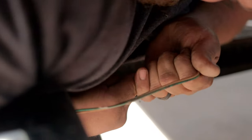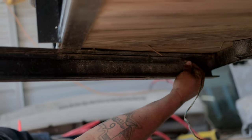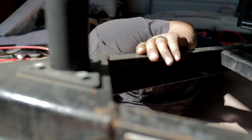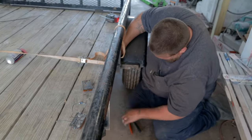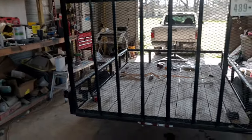These wires run all the way to the front through this tube. There's a tube on the inside of the trailer and it comes out right here. I don't know what they put in these wires — it's like there's some kind of glue or something in there that makes it hard to break loose. It goes all the way to the front because it connects to the new plug to the truck. The white is the ground, the yellow and everything else all comes into this side. You also have lights on the back — those three red lights connect to the running lights so when your lights are on at night, people know there's a trailer back there.